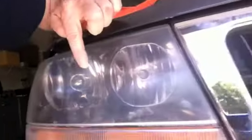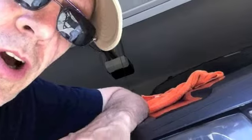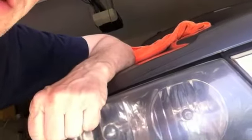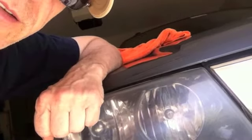Alright, well, I've used the P3000 sand grit on about half the headlamp, and I'm going to just dry it down here. If you look close, right down in here, I can still see the horizontal lines over here, but all the horizontal lines have gone away over there. I've sanded them down. So that's what you want to do with the P3000, is go up and down, go vertical, until the horizontal lines or grooves have disappeared. Almost done. Let's get this done.